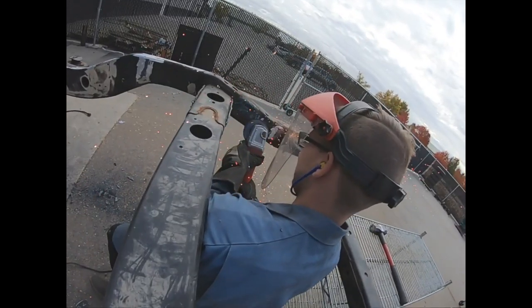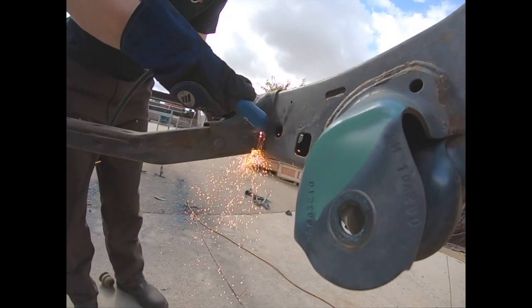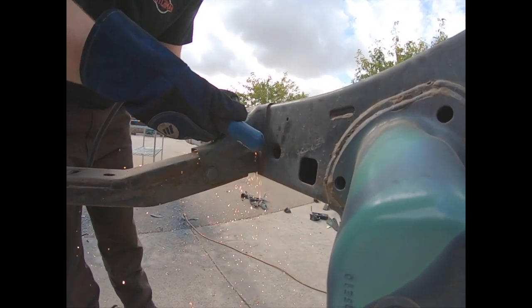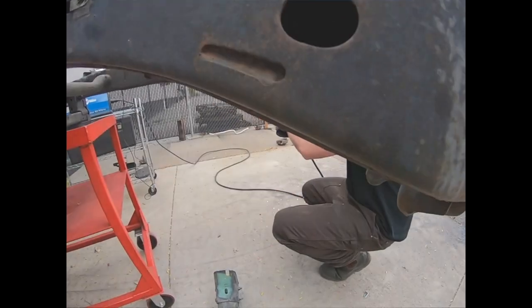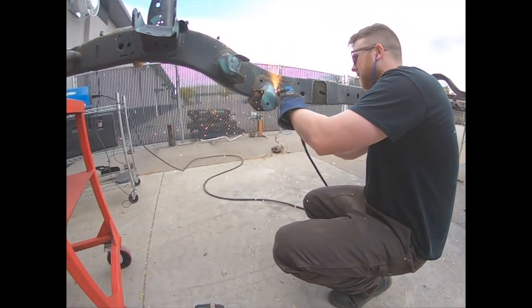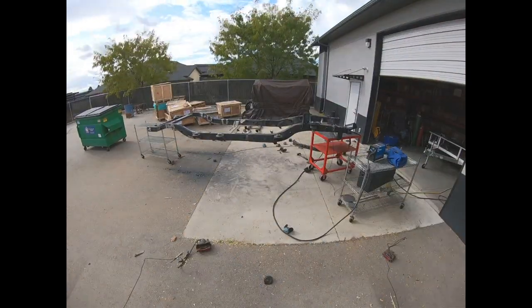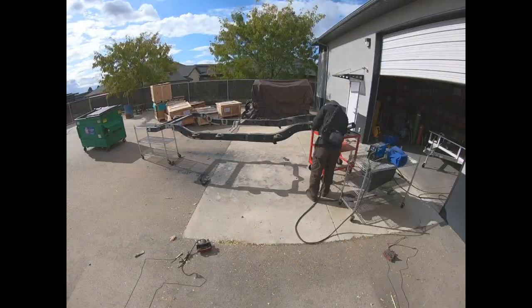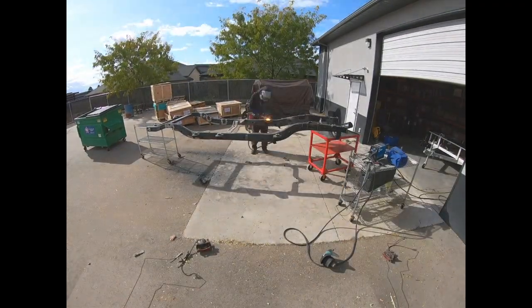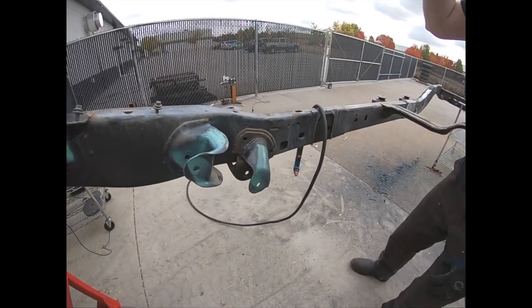The bracket removal was fairly straightforward, and depending on how thick the bracket or weld was, we used either a cutting torch or a plasma cutter. The cutting torch works better on the thicker welds and the plasma on the thinner brackets. And to be safe and avoid any miscommunications, we marked all the brackets that will be removed with some green spray paint. All that removal and grinding and sanding seems easy enough, but boy, is it time consuming and tiring.